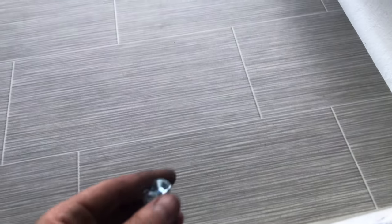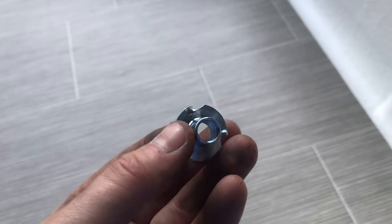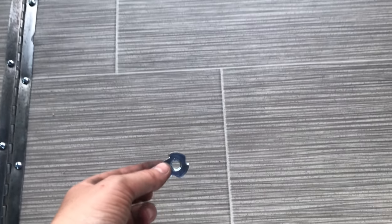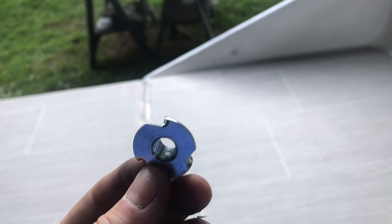So everything underneath, all of the points where this trailer is held, or the topper is held to the trailer frame, we used T-nuts. And these are a pretty neat little design. So basically, up here on top I have one of these down into the wood, and then from the bottom they're threaded. So from the bottom I can just thread my bolt up through, and it actually sucks the two surfaces together. And then it also serves as a lock washer, keeps it from backing off. Lock washer on this side. I went ahead and put one on the other side as well.